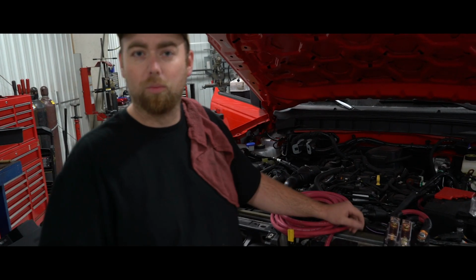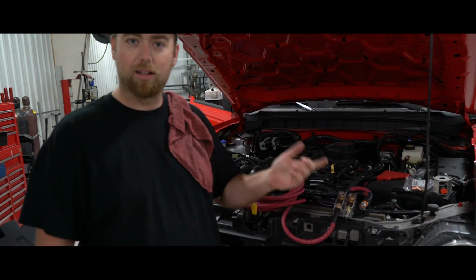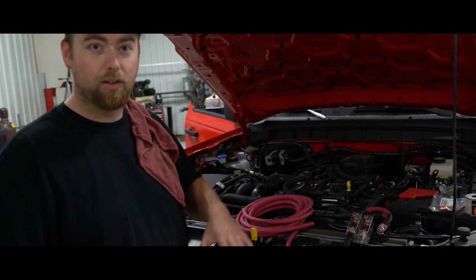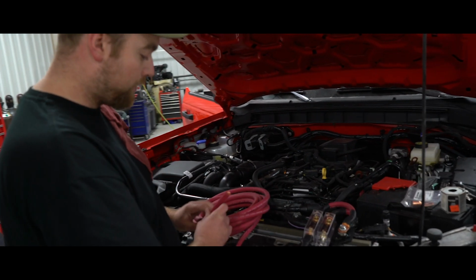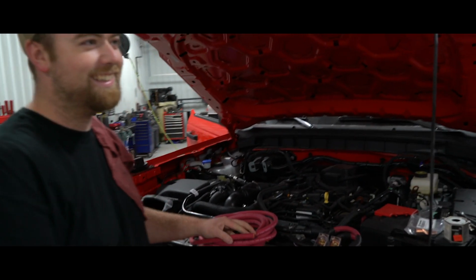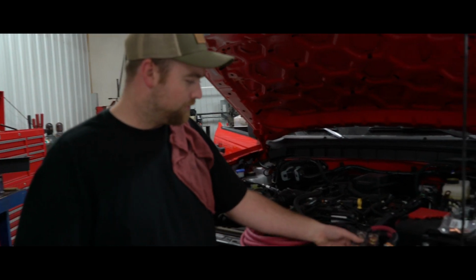All right, for the past few days I've been wiring this thing, and it's been quite a challenge because we're putting so many accessories on this, as you may think with a fire truck. So we've got the flashers on the fenders. We're gonna have flashers on the back also, and flashers on our new front bumper. We're gonna have rock lights on here. We're gonna have a light bar across the top, our light mounts on the cowl, and then we're also gonna have big power go into our winches. So this is gonna be to run to the rear, and you want big power. Big wire. So we're gonna throw a couple Warn winches on this thing. One's gonna be in the rear, and being that far away, you're gonna want a big power wire.